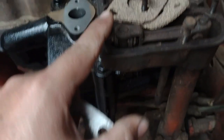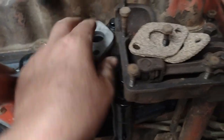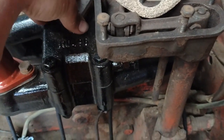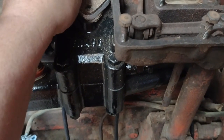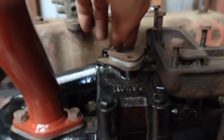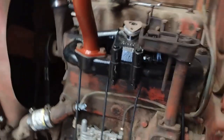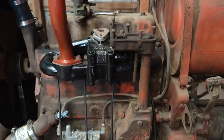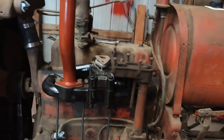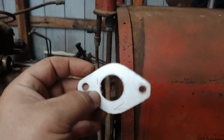So what I'm going to do is put two of these gaskets on along with the aluminum spacer. By the time I torque it down, that gasket material will compress and it'll be just a hair over five-sixteenths — which will settle to where it needs to be. Shop fix. They no longer make that piece — nobody makes it, Case IH doesn't carry that spacer anymore. Here's my gasket template that I made off of it.